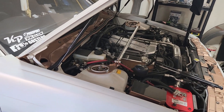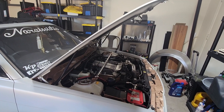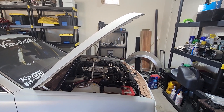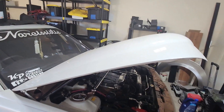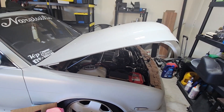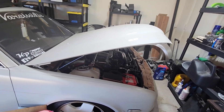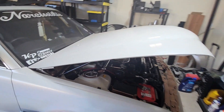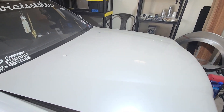Both struts are installed. As you can see, the hood is sitting up just as high as it was previously and now it has pressure — it will hold and stay where you put it. So if you're doing car shows and put a hood prop in, it's going to stay there. The Santa Fe strut has enough force to hold the Nissan hood up, rated at the same pressure.